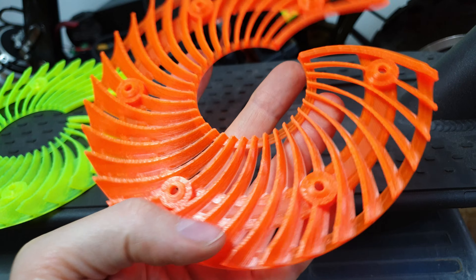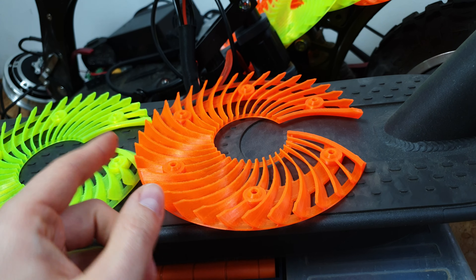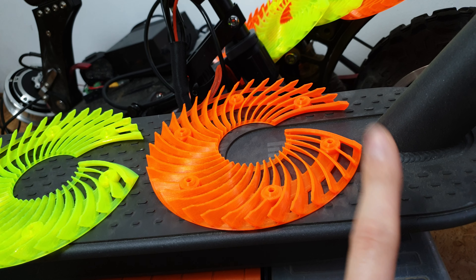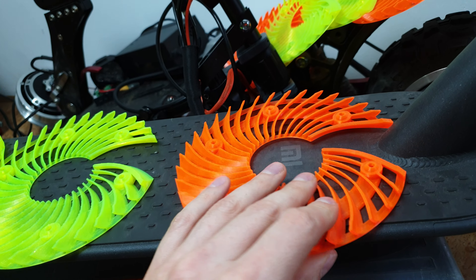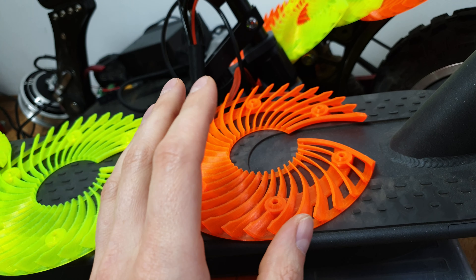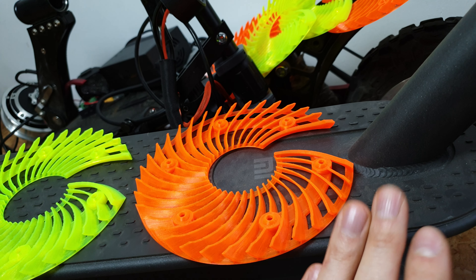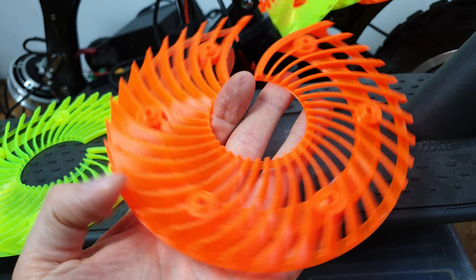Next week I will increase the power on my Xiaomi Pro to about 1500 watts and show you how to do it. We'll use the MAX cooler, I'll change the MOSFETs on the motherboard, and I'll also show you how to do that. I'll add a fan on the motherboard too, so this Xiaomi will be like 50% more powerful.